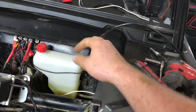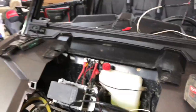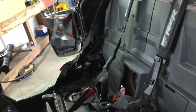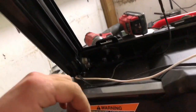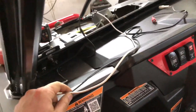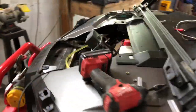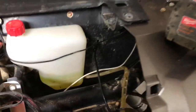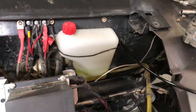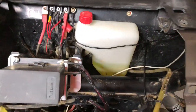What we're doing is running the power and ground wire. I'm going to show you quickly how I've got that ring — this wire is already insulated and it's rigid enough that it's easy to run off to the cage. Here's the other end of the wire coming through the cage hole — it runs down the A-pillar right here. This is excess stuff: my subwoofer RCAs and a light bar wire I'm going to clean up. It runs down into the fender, and I chose to use a hole I had already tapped, running it through there and probably behind the antifreeze reservoir.